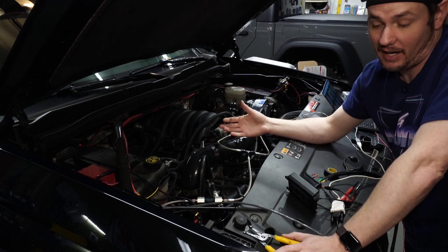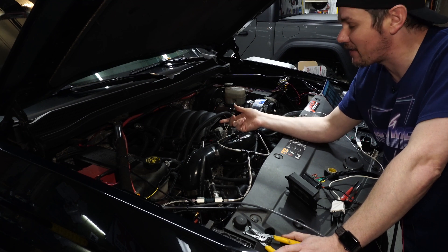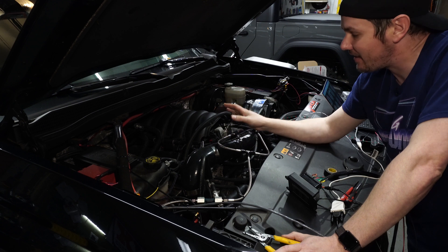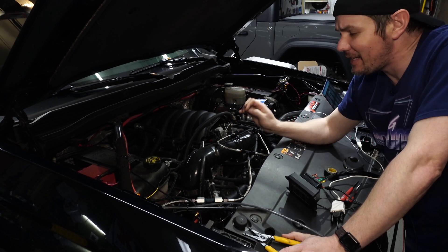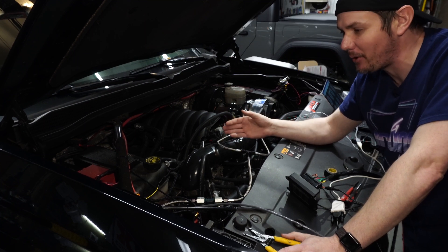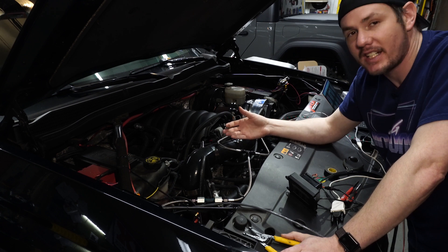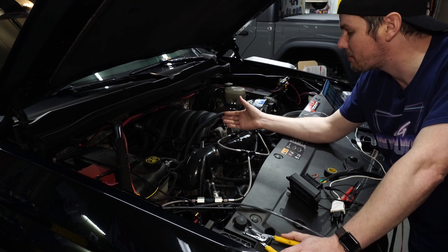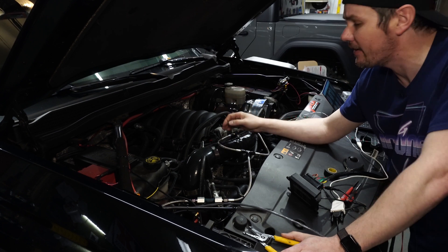The only way I could figure out how to do it properly was to adjust the cylinder count in the software from eight down to one cylinder. That way, whenever it sees the pulse, that counts as one revolution instead of having to see eight pulses or missing teeth. We've got this thing set up in fuel only mode, so we're not using any of the timing tables. If you know of a way to alter the input signal to get it to read right, hit up the comments. I think it is an oversight on whoever developed the program — not being able to set up a custom trigger in fuel only mode. So by spoofing it and saying we only have one cylinder, it works. I don't know if that's going to cause an issue later on whenever we get into fuel delivery.